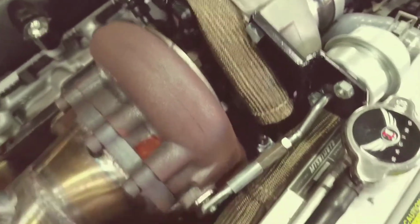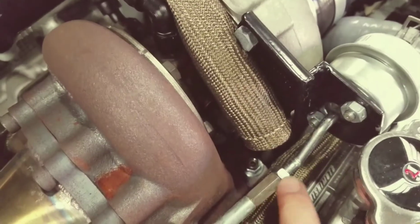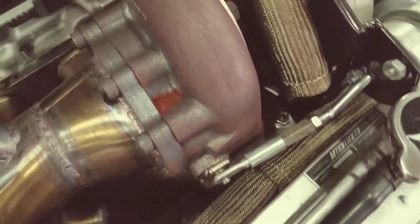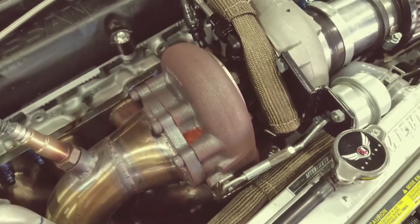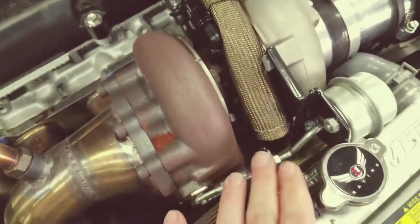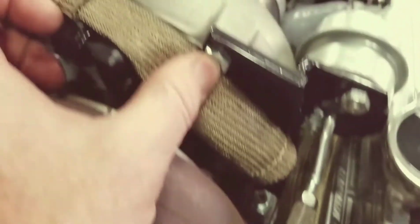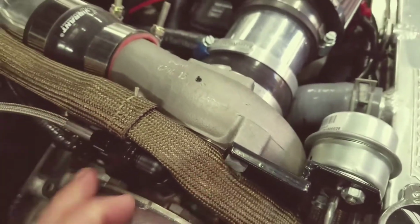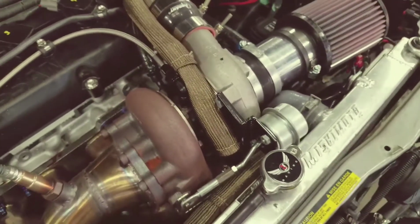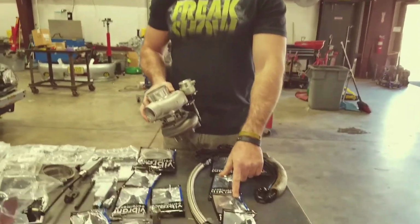Once you get the turbo, also check the coupling nuts and the nut on the wastegate too. Check these nuts as well. Every, I would say probably, week to 2 weeks for at least the first month, always check these bolts on the downpipe, the bolts on the manifold. These, just because from heat, expansion, contraction, they come loose. And the ones that hold the wastegate to the turbo all come loose because it's a QR and it vibrates obviously like crazy.